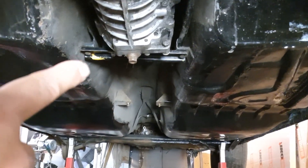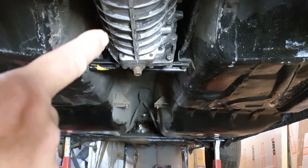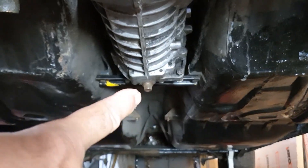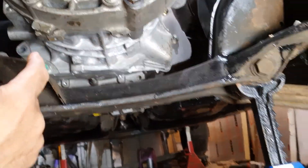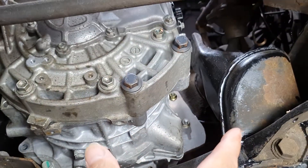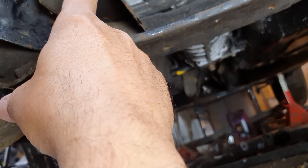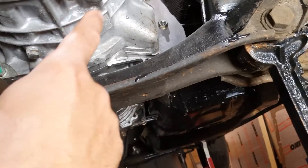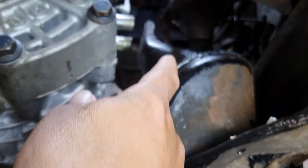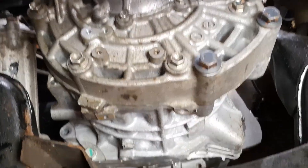There's a cross rail under the car and under that is a tiny little rubber mount, so that original gearbox is sitting theoretically in the correct place - there might be some minor adjustment on the fixing bracket. I looked on the forum and some people have said just get some five mil steel plate and start welding off the original mount, which is pretty much underneath there. I assume the mounts will come off at about a 45-degree angle to support the weight sideways. Obviously I'm going to be losing this mount on one side unless I can weld something - ideally that position is strong enough since that's where the original mount was.